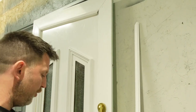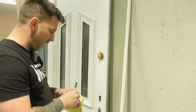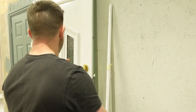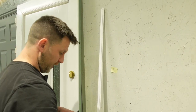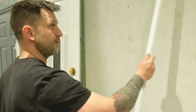Make sure you're labeling your beads. I know it sounds obvious but if you don't label them - which one's for which - you'll actually have more problems getting them back in, because one might be slightly cut different to another. We'll put an R on it for right. Just like so, and then stick that around the bead and put it to one side.